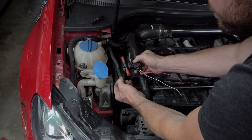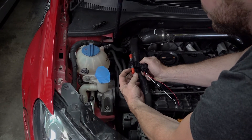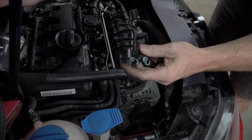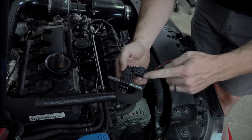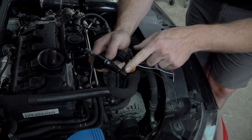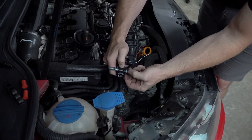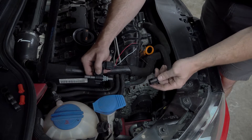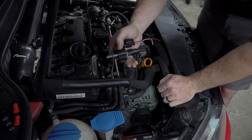You could either just cut this with a knife and clamp directly to either side, and that would work just fine as long as your clamp is nice and tight and you've got all the hose pulled up to the bump. We've opted to use a couple of quick connects for convenience. These are designed to clip right on to both ends of the sensor — this is a GM Continental ethanol sensor with 3/8 fuel line. The quick connects clip on and can't come off, and on the other end there's a barb fitting where you can slide the hose over. After installation you can depress the two tabs and easily disconnect your fuel line if you need to purge fuel or clean the ethanol sensor.